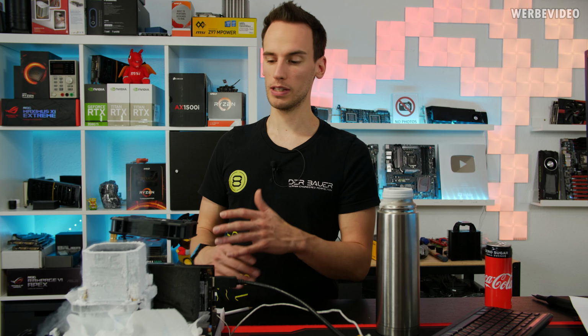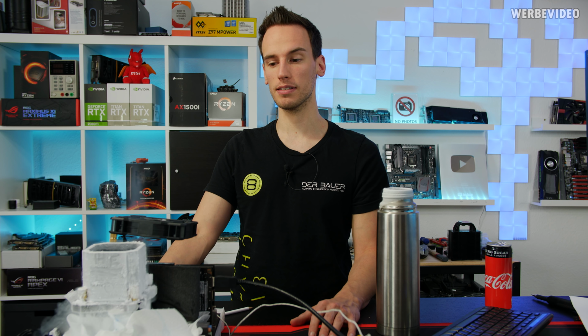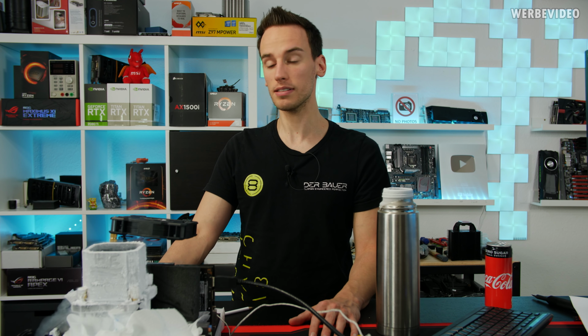To be honest, I mean, those CPUs are still fun to overclock. They overclock really, really well because you can go down really low in temperature. They scale really nicely with cold. But in the end, the 10900K feels still the same, like 9900K, like 8700K, like 7700K, like 6700K. They're all pretty much the same when it comes to LN2 overclocking. All scale really, really nicely with cold. Starting from 9900K because they're soldered, it's a lot easier for overclocking because you don't have like TIM cracking and stuff. And the mainboards also developed further. That's why it's even easier for us for LN2 overclocking. All the CPUs have been the same. ASUS and co, they figured out how to improve things. It's really easy. It's still a lot of fun.